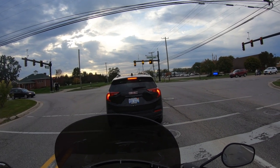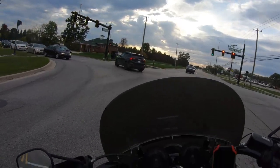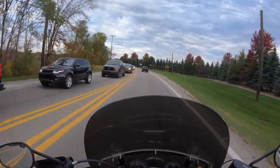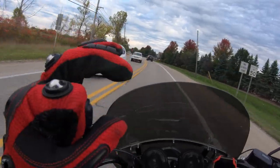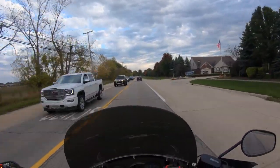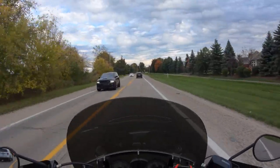It's sitting low enough to that little sump area that it'll throw the oil before it can actually get into the return. And if you look at the video of that, the return hole to the oil pan, which is located underneath your transmission, is just one dinky hole. And I feel like the reason the Softails have that is because you can visually see there's more oil returns going to my oil pan underneath the transmission.